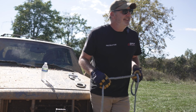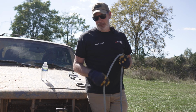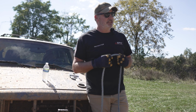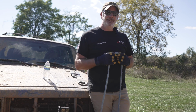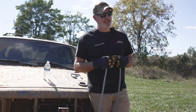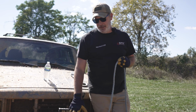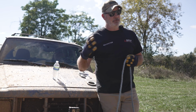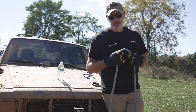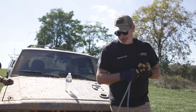Don't go with Harbor Freight. No, I'm not a big fan of Smitty Built either. I know some people like that, but it's just a cheaper winch, and they're saying, "Oh, I just use it twice a year." I'm like, well, that's not really a good excuse. It just has to fail once, and then you're kind of screwed. But the most common thing to fail is going to be the solenoid on these things, just because they get wet and dirty. They go through heat cycles, and they tend to fail over time. But that's going to happen with any winch.